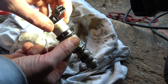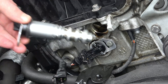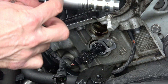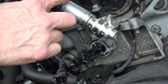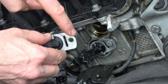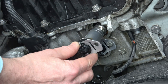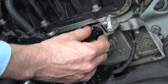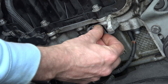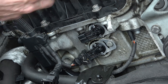We're going to install it again. You can see I've got the o-ring and the spacer here — spacer on first, then the o-ring. To install it, I'm just going to use a little bit of oil just around the o-ring here to help it slide in a bit easier. We're going to install it with the hole for the bolt towards the right-hand side, electrical connector towards the left-hand side, just like the one underneath it. Gently put it into position — it will take quite a bit of strength to push it in because the o-ring is going to resist. There we go, that went in nicely.